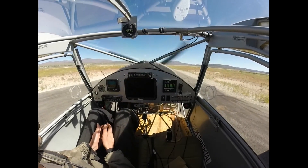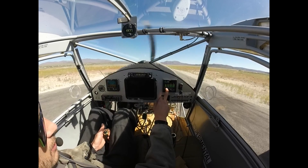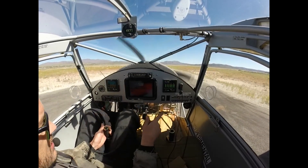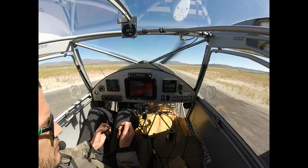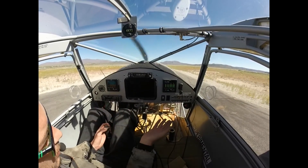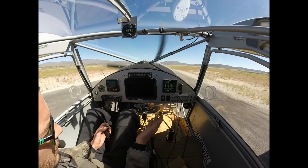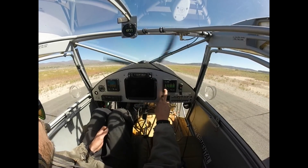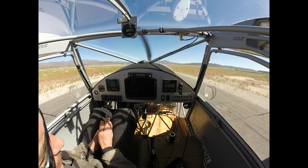So both of them are rich. We're going to start from wide open throttle and work our way backwards, just like you would with any motorcycle. Once we're able to get decent oil temperature and make an actual full power run-up, we'll full power run-up, let it stabilize, and take note of what our readings look like on both sides. Once we get those readings, we'll pull power to about mid-range and do the same thing — let it stabilize and get our readings again — then finally pull back to basically idle. We have 123 degrees on oil, 52 psi oil pressure, CHTs are at 144, and EGTs are all in the green.